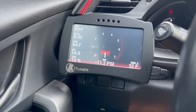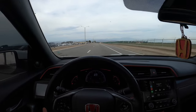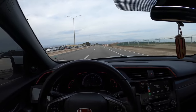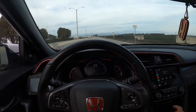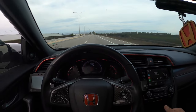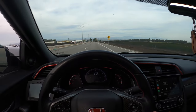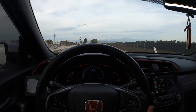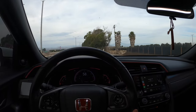That should lower it down like another 2%. After driving on 91 for like a few days, 91 is so much slower than an E30 tune. I'll do like a 50 roll in third gear. It's 23 pounds of boost — it's not what I'm used to. Going from an E-blend to like straight just 91 sucks.